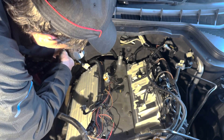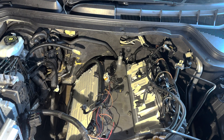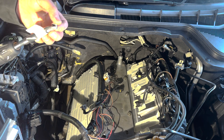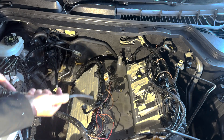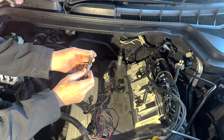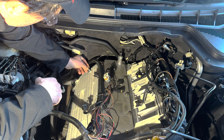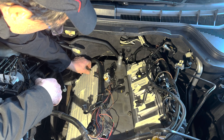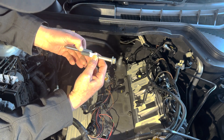What I'm doing now is finessing the top of the hole so that it's countersunk — the countersink is created by the angle of the drill, which is what it would get if used with the tool supplied. We'll clean it up. The test is whether the insert will go in: obviously we haven't cut the thread yet so I'm not putting it in, I just want to make sure it can go down the hole so we have enough diameter. And it does — that's where it would start. We've got the right depth — that's spot on. That's our starting point.